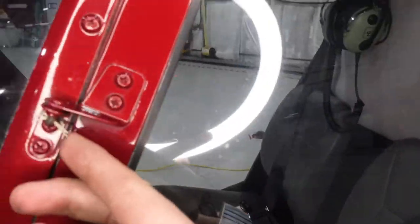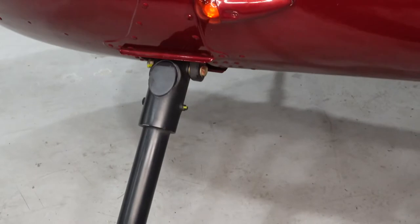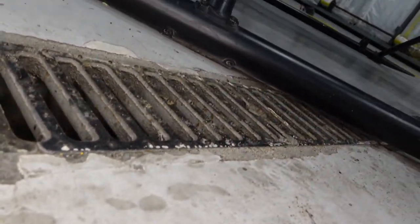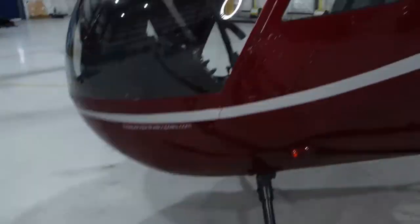Check the door hinges and safety pins, making sure those are in. These doors can pop off super easily, so make sure those pins are in. Then the landing gear — checking all our torque stripes and that cross member on the bar. On the bottom of the skids, we have skid plates so we can run the helicopter on the ground. We don't have to replace the skids — we can just replace the skid shoes. Always make sure there's some material there and they're not all the way worn out.